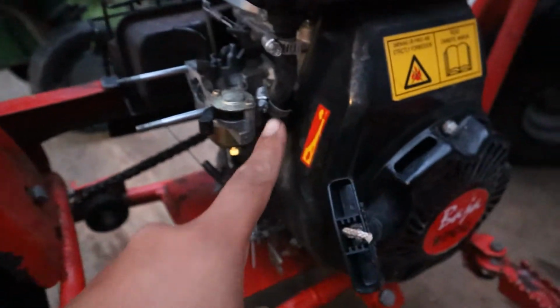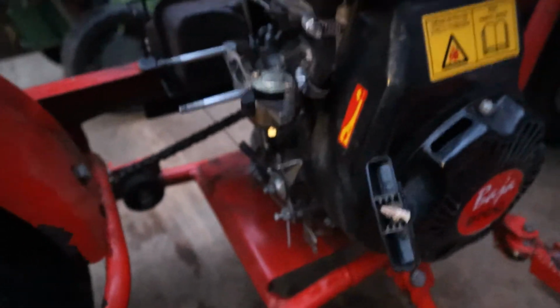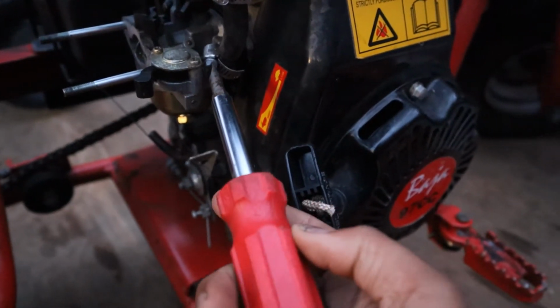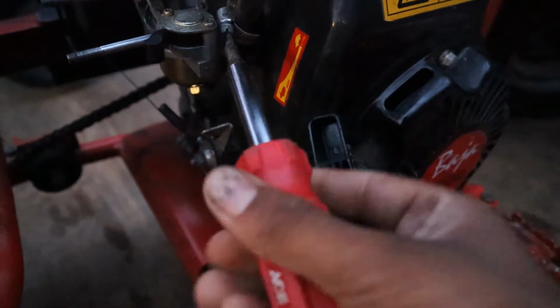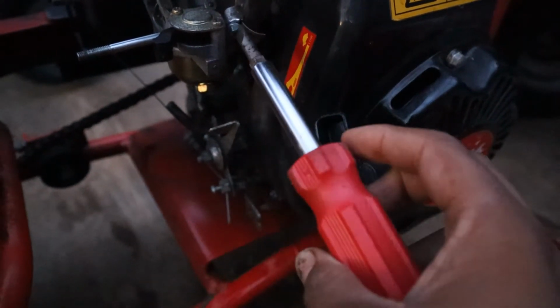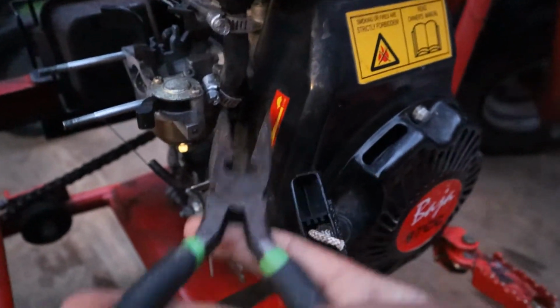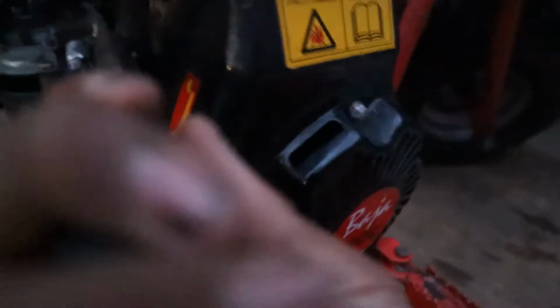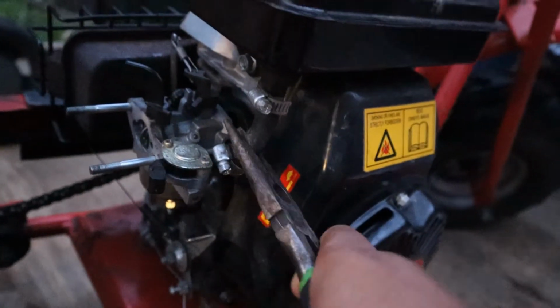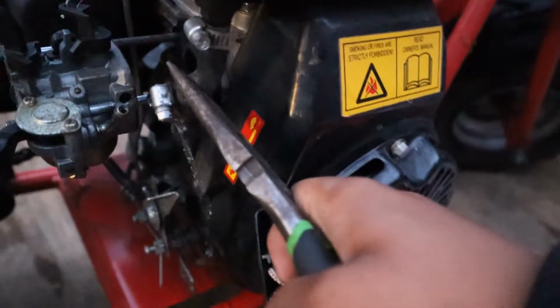And we're gonna have to move this hose clamp right here. And we should just be able to pull it out with the needle nose pliers. So I'm gonna start removing it. Okay. Oh, you can already see it leaking, as you guys can see. So, you're gonna pull it out now. Oh, the carburetor's starting to slide out, so that's good. Dang, it's hard. Alright, there you go. Bam, just like that. Alright, it's already leaking.